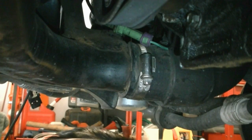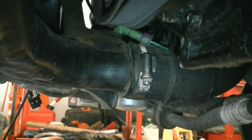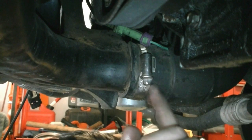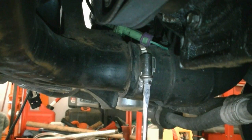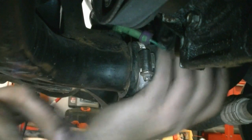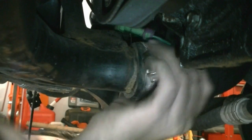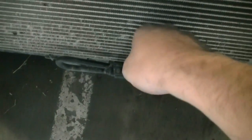For the next step we need to remove this hose that comes from the turbo and runs underneath the car to the intercooler — it's on the right side of the engine bay area. We first loosen this, then twist and pull. Next we're going to remove this outside air temperature sensor; there's enough slack in the cable but just to be safe we're going to remove it.